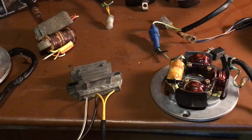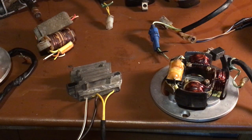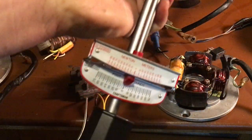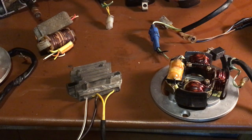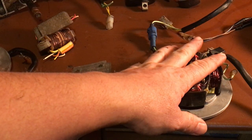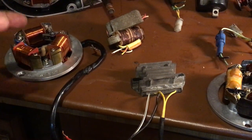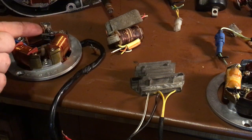CDI is also maintenance-free — you don't have to pull the flywheel off. With points you have to pull the flywheel, buy specialty tools, and torque the flywheel bolt down to 36 foot-pounds every time you do maintenance. With CDI you put it on, get it done, and forget about it — you just put your ass on the seat and ride.